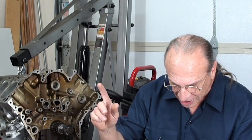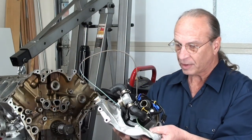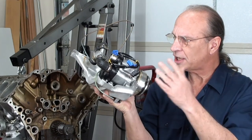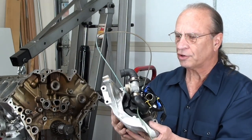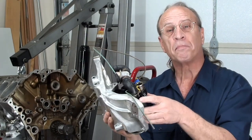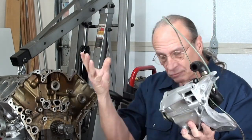I want to thank my new subscribers. Whether you've been following me or this is your first time seeing me, I've taken this car completely apart and every little component has to be put back together. For example, this is the smog pump, or air pump. It has a couple of components: a clutch, a pulley, and some circlips. We've also got this valve. We're going to bench test the valve, bench test the pump itself, and bench test the clutch — and we're actually going to change the clutch.